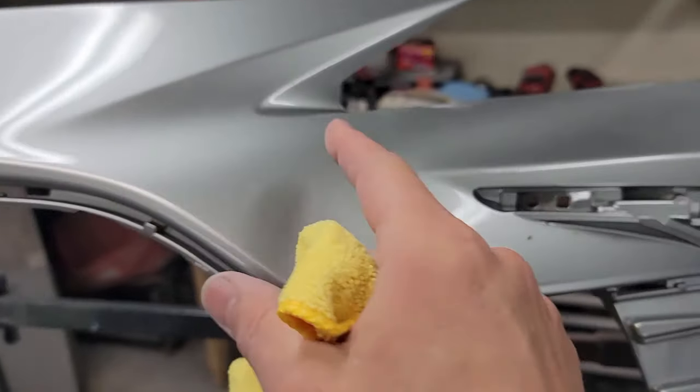Okay, ready to paint — just need to mask this area off. It doesn't really matter if paint gets on it, but I don't want dust settling in these pockets and blowing out the clear later. I'm going to go around the bottom and push a piece of paper through here and tape it to the back to cover about 80% of it. I started with 400 grit, then took it to 600 with the DA everywhere I could reach, and used a scuff pad everywhere else. I feathered the edge out with 600, then 1000 by hand all the way across.